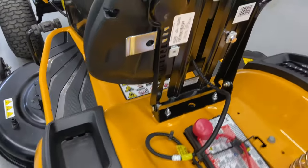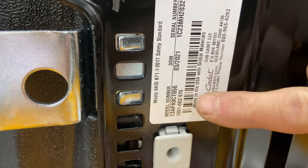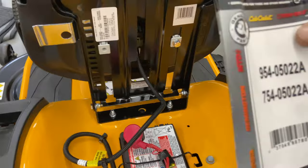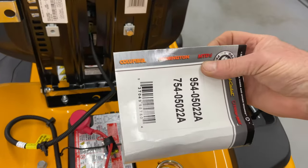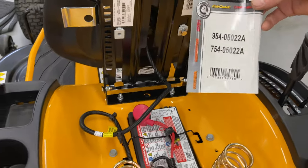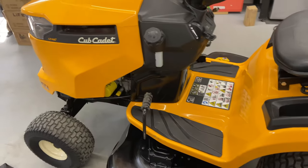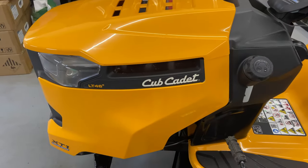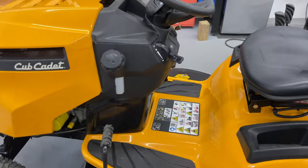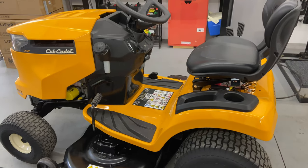I did want to show you one other thing about ordering the belt. If you're going to order a belt, you're going to use the model number here — which is 13APA9C2456. Take that model number, go to Cub Cadet's website. This is a Cub Cadet but it's actually made by MTD — as you can see, MTD, Troy-Bilt, and Cub Cadet are all made by MTD. This is an MTD part number. Go to their website, look up the belt, and you should be good to go. That pretty much wraps it up for how to install a mower deck belt on an XT1 LT46 Cub Cadet. If you have any questions or comments please leave them below, give the thumbs up, please subscribe, and I'll catch you guys on the next one.